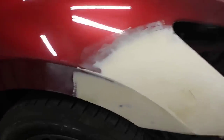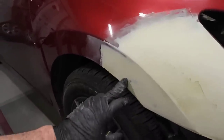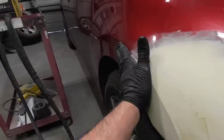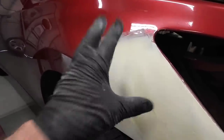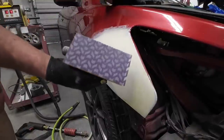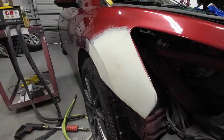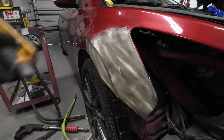We knocked off the roughness just a little bit. You can see there's a little bit of a low spot there, but we're going to start blocking before we determine where the low spots are. I do see a high spot here — I was able to hold my DA flat on this section and there is a little bit of a high spot. So we'll probably put a skim coat of icing over this to smooth out that transition. I'm going to get a block with some 80 grit on it and block sand this out. I'm using a Cubitron 2 sandpaper with a short block, and although it's not a flexible block I can still work with the contours of this panel. Let's put some guide coat on it so you can see what's going on — this is going to show us any high or low areas and help us determine if the panel is straight.